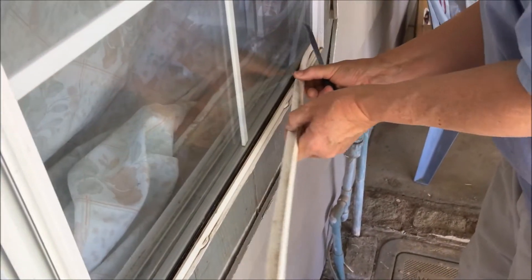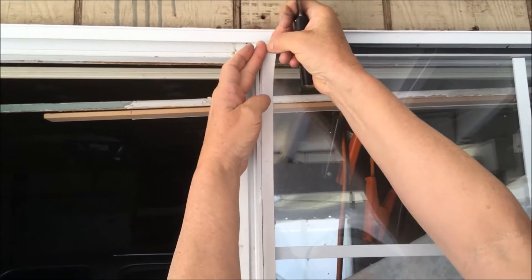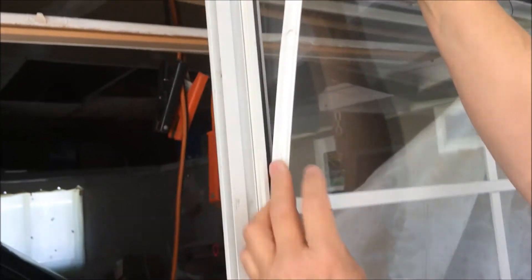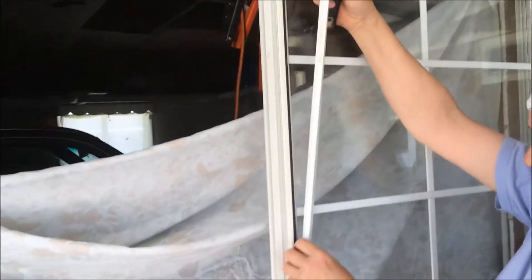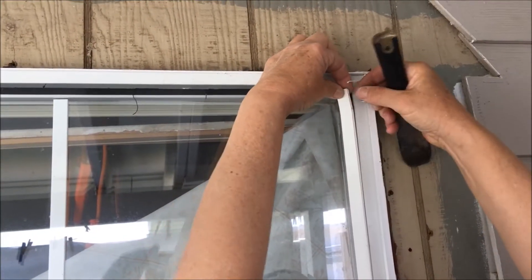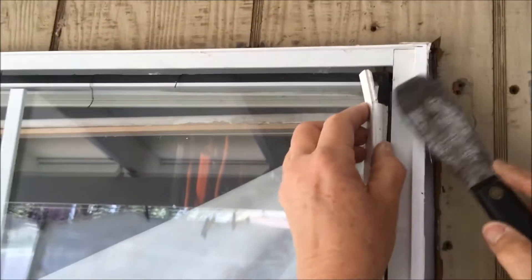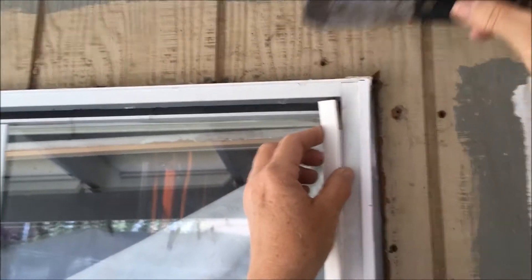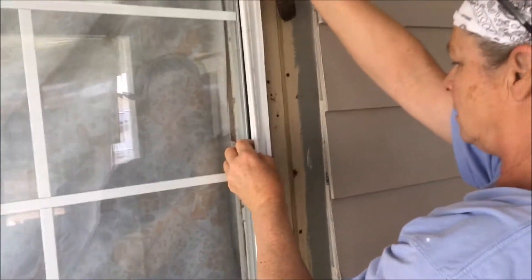See it coming away? When you have to replace a pane of glass like this one, this is how you do it. Maybe rolling it out towards you a little bit - those are the goobery things that stick to it. Just be gentle with the trim or it'll break - it's brittle and old. Kind of roll it from the top, roll it out, curving it out like this.